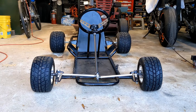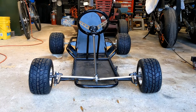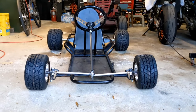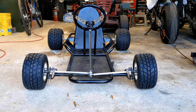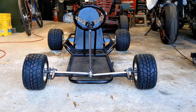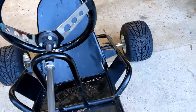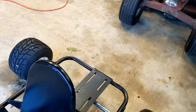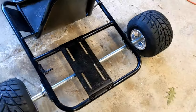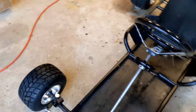I've been talking about chassis setup and why you would want toe, camber, caster, Ackerman, and all that good stuff. I've got the wheels on and everything. If you've got a live axle cart — where the engine drives both of the rear wheels — when you turn, the cart is going to want to go straight. You can hear the wheels scrubbing as I turn it. So on a cart like this with a live axle, it's going to want to go in a straight line all the time, which means when you turn it's going to push — understeer — wanting to go to the outside of the turn.